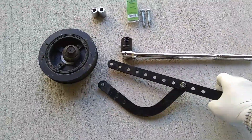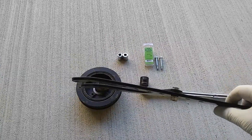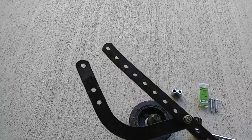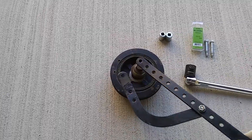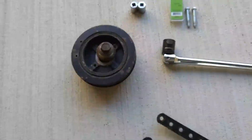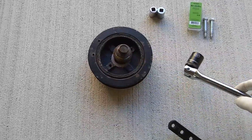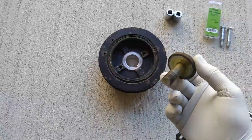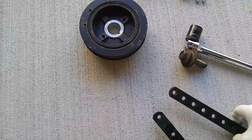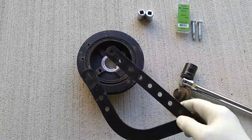This is a piece of the garage opener rail. You can see that I slightly bent the ends, and I used this to remove a very stubborn bolt on a pulley. Usually this is a 22mm bolt, and usually a high torque impact gun will take care of it. In my case, it was not possible, so I had to block the pulley — and for that I used this little tool.